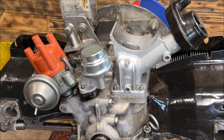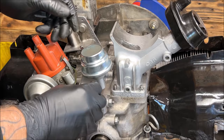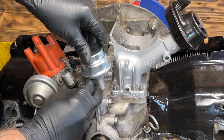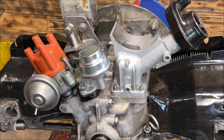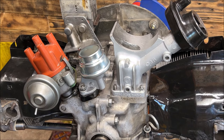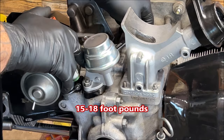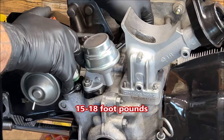Let's take our fuel pump and set it into place. We're going to use our wavy washers — you know what they are. Put the 13-millimeter nut on; push down on it a little bit to make it easier to spin on. Try to tighten them down evenly and make sure you use the proper foot-pounds. Go back and forth between front and rear to tighten evenly. That's odd — my socket has always fit on there before; I think they changed something on a newer fuel pump design.